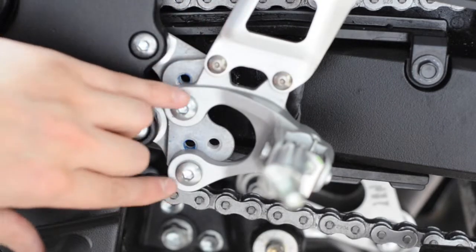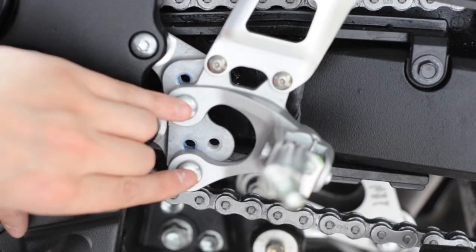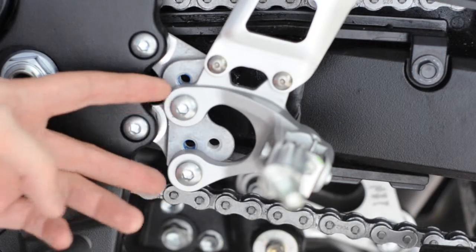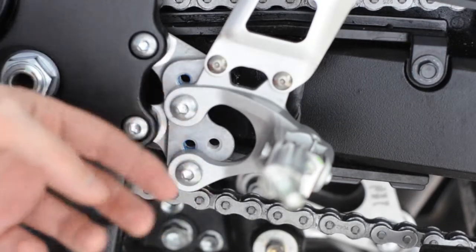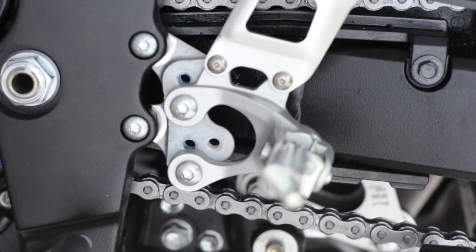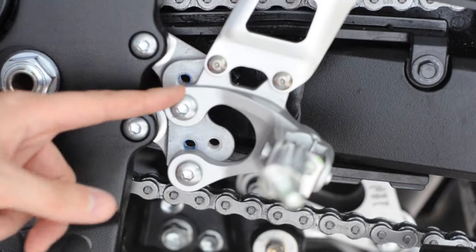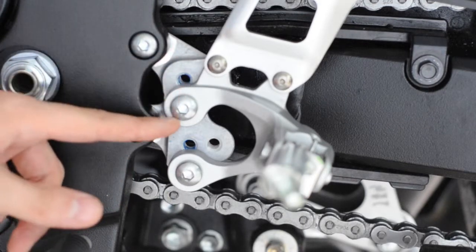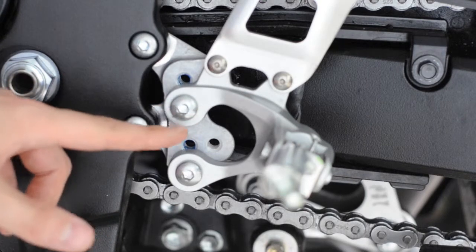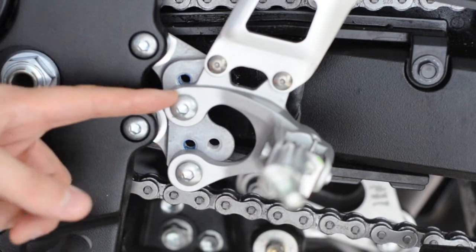Initially I just dropped them to see what the ergonomics would be like, and I'm actually not all that comfortable with it. The problem I've got now is that I've just sheared these bolts, which is bloody typical. One of the biggest problems with these is that the bolts — this is very typical of Suzuki — are not a standardised size. These are 5.5mm.